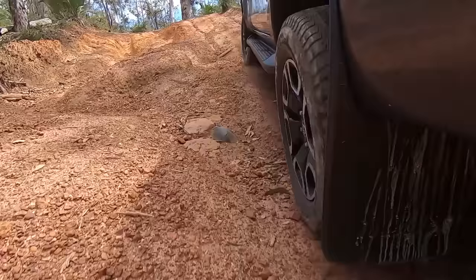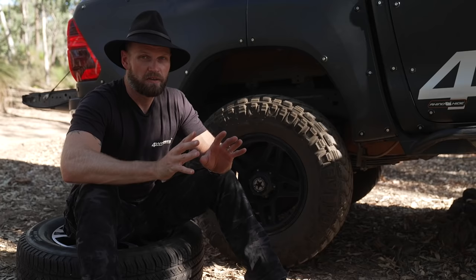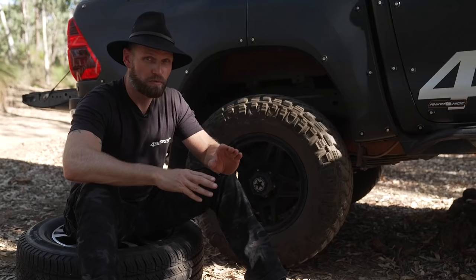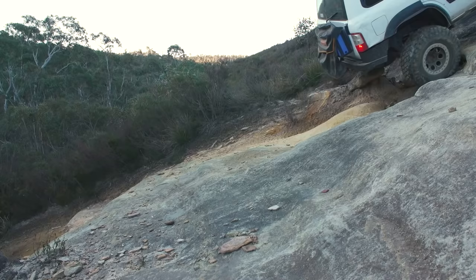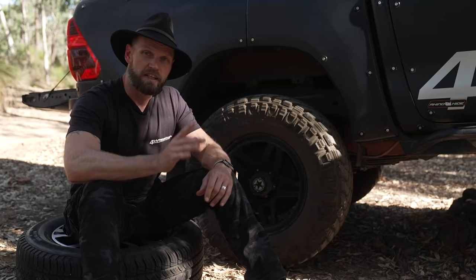Keep in mind, that was at full highway pressure. What about off-road tyre pressures when we lower the tyres? When we drive on sand we must lower those tyre pressures — if we don't, we get bogged. If we don't lower them enough we risk getting bogged and using more fuel. On rocks, if we don't lower our tyres we skip around and can damage the underbelly of the vehicle or even the tyres. Going up or down a sketchy hill without lowering your tyres means your footprint is much smaller.